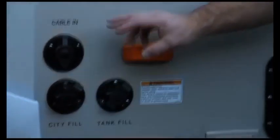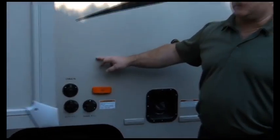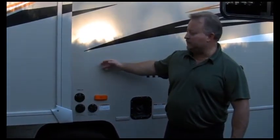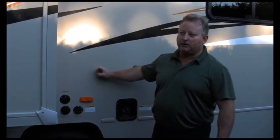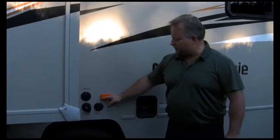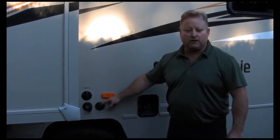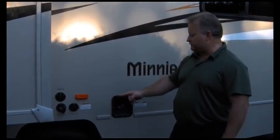You've got water fill. Your water fills will either look like this or you'll have a white box, usually white on the outside of the compartment that says fresh water only. You'll have a city water hookup and a tank fill. The city water hookup is to use pressure from the hose — that's what ours is here where it says city fill. The tank fill is literally putting your hose in your tank and adding water. On our motorhome, sometimes the tank fill is on the passenger side; the city fill is always on the driver's side.